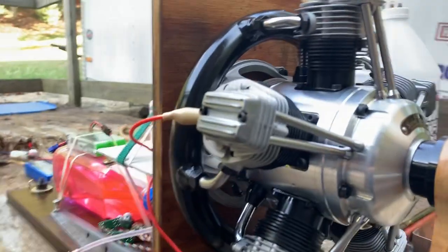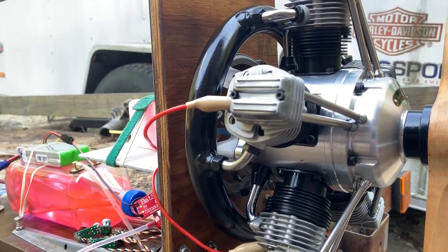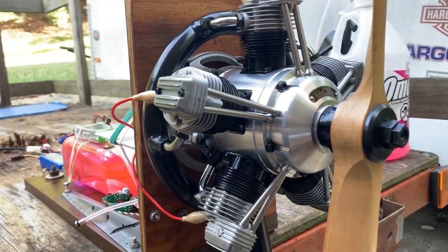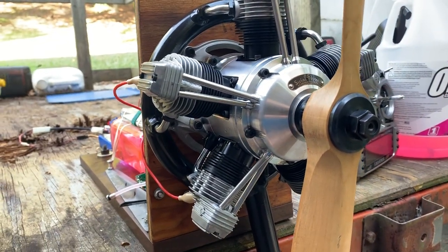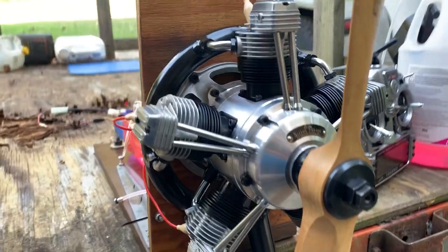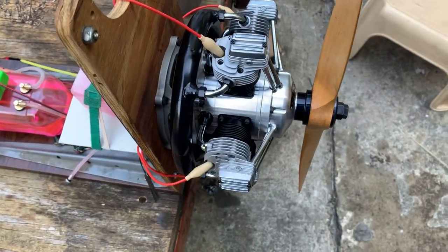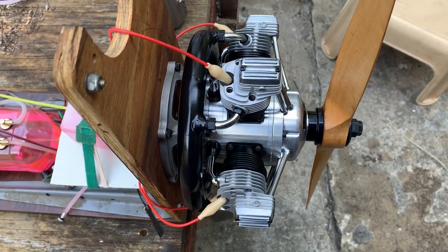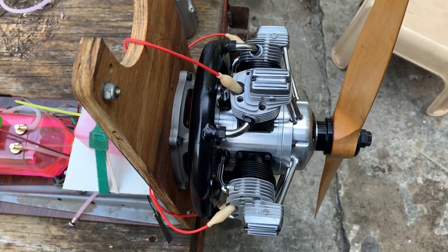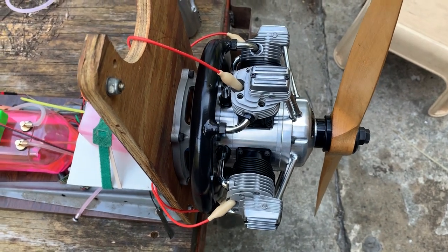I just recently installed this nice collector exhaust system. I can't remember the original manufacturer's name but I bought it from Morris Miniature Motors in England. It fits a little bit critical but it fits. I also changed the valve clearances last night after putting the exhaust system on, which meant tightening up the clearances. It slowed down the idle quite a bit — makes a difference when you have the valves opening more, as you trap less compression gases in the cylinders.